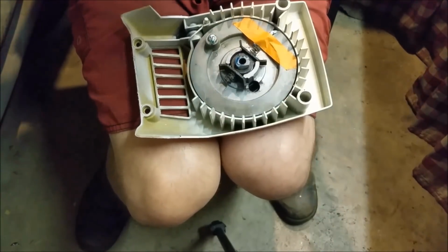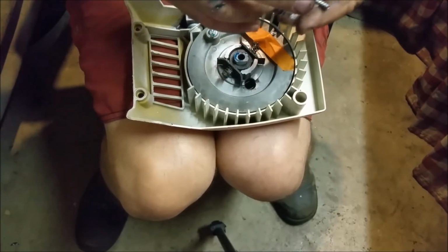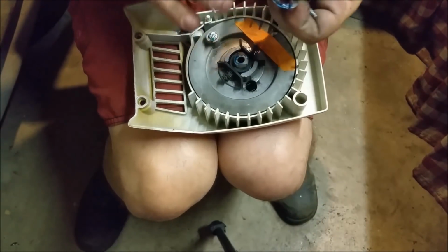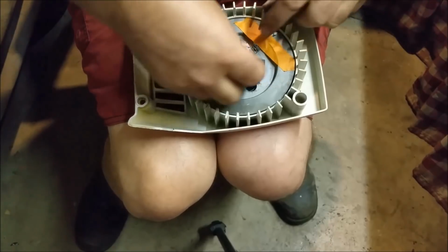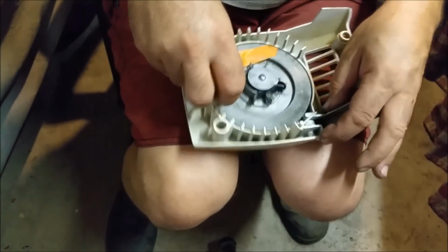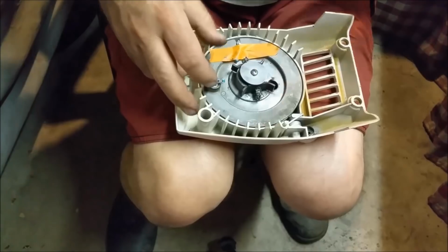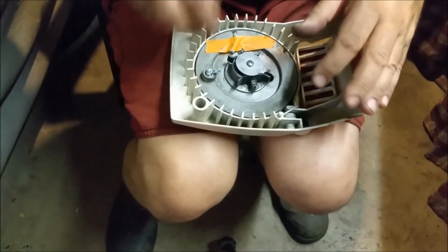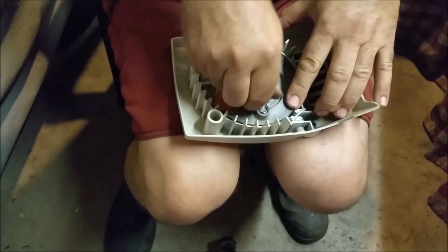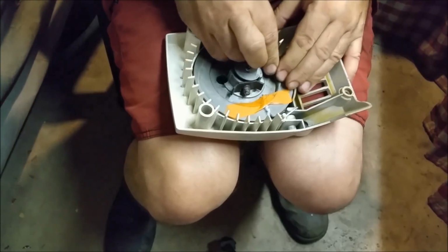And what I'm going to do is get the string out of there and stick it in through that hole. So I'm just going to button all this stuff up first. There's another washer. Like that. All right, so we put those on. We've tightened that up. We're good. So we've got to wind it. Depending on which one you do, some of them need to be wound. One was wound four times, which I think is too much. I'm just going to wind it a couple. So we go one, two, and I'm going to bring that around to there.